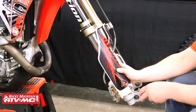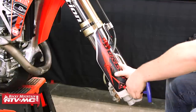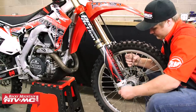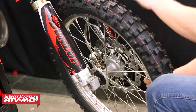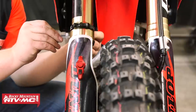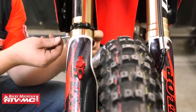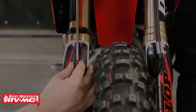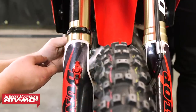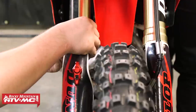Then we can go ahead and reinstall this fork guard back onto the bike. Once we've got those bolts in and tightened down, we can install the front tire back onto the bike. We're going to torque all that hardware back to the factory torque specs. The last step of this install is to line up the trigger and the fork ring. One way to do this is to tie the bike down in the back of a truck or trailer and compress the forks to allow you to line these parts up. For this bike, we're just going to lightly snug down the pinch bolt on the fork ring so we can make small adjustments but it won't rotate freely on the fork. After that, we're going to use a screwdriver to visually line these parts up. And then once we've got everything perfectly lined up, we can torque the fork ring pinch bolt down to six foot-pounds.